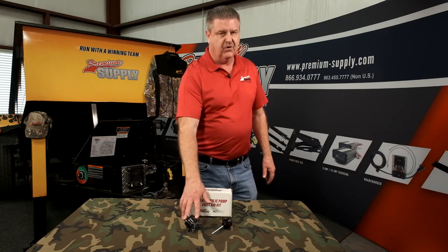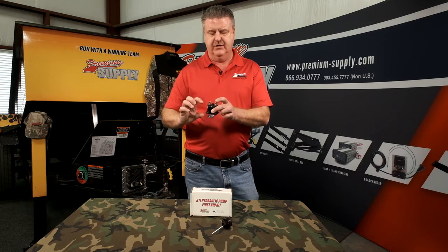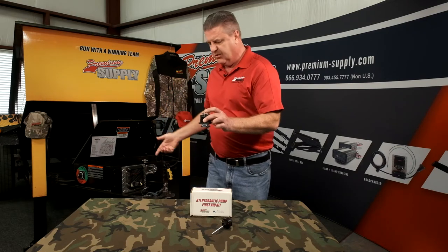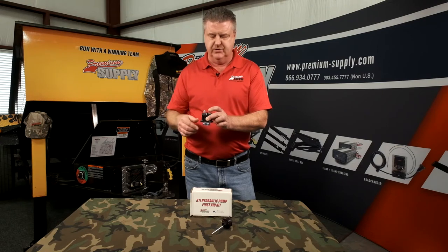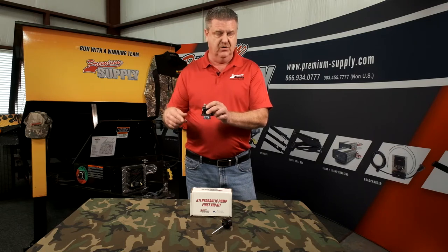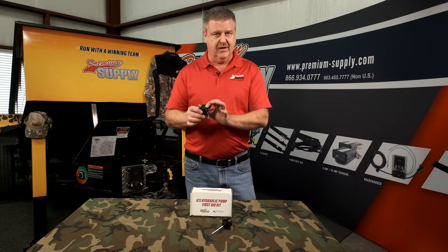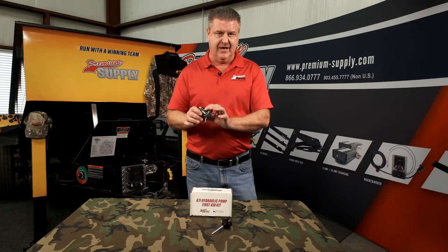One of the many things we talk about is battery problems. Everybody has them because you're pulling a lot more amps than you normally would with your vehicle. The first things that go out when you start getting a low battery is your start solenoid. This is a magnet inside — with a good strong battery, the magnet is pulling down and getting you started on the electric motor, closing your circuit so your pump will do its thing. When it gets weak, it kind of dithers, gets a little powder in there, and these things either weld shut causing your pump to run until it burns out, or it burns out on its own. This is the most common item to go out because of a low battery — not because the pump has any issues, but because your battery is low.